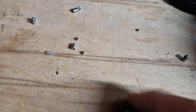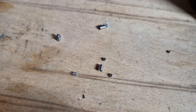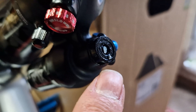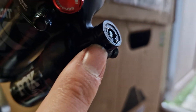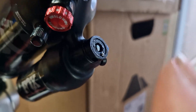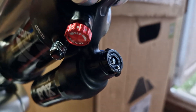Once you've got them all in, you have to move over to the body of the bike to take the cap off and push these pins into a gap. Once you pop that cap off you'll be met with this — there's a little bearing there that's already in place, so you don't need to use that fifth one in the kit. Then slot each of those pin assemblies we just greased up into the four slots, with the bearing going inwards. Put a bit more grease on top so it's nicely greased up, because once it's on it's going to be near impossible to get off.